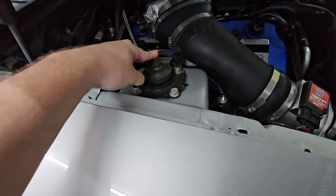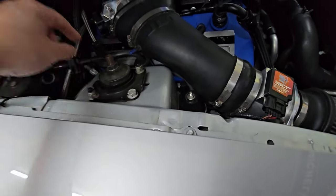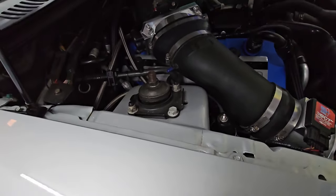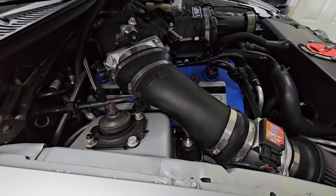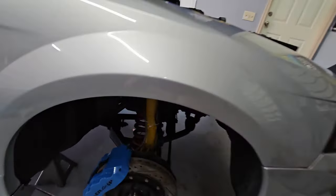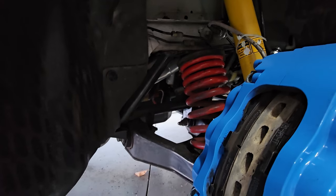You're gonna pull off the nut, remove the factory camber plates, and then you actually use those as a guide to drill the fourth hole for the MM ones — which is kind of a pain to drill through the shock tower since it's pretty thick. But if you follow the directions for the MM stuff, it's pretty straightforward. Once I do that, we're gonna start tearing down and swapping out the CPR camber setup for the MM stuff.